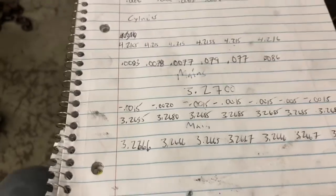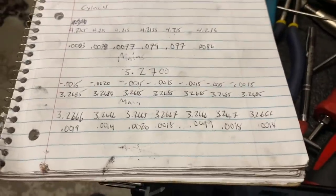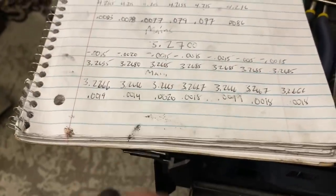Now that we got our mains, we subtract the main cap measurement from the mains and get our oil clearance. We've got about two thousandths; this one's a little tighter at a thousandth and a half. If we were building a stock engine I'd leave it — factory spec is one to five. Since this is more of a high performance build, we're going to swap these out for HX bearings, which will give us an extra thousandth of oil clearance, ending up with just under three thousandths on the mains. You can also flip half the bearings to H's and half to HX's to dial in half-thousandth increments.